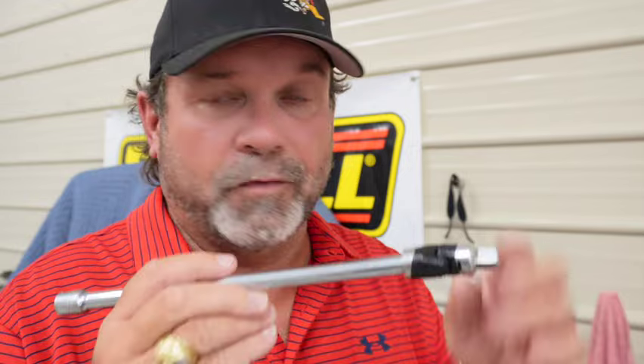If you notice here, there's a universal joint on an 8-inch extension. If you ask yourself why I have electrical tape around this universal joint, go back and look at a previous video on a hack that I did on this — it'll make your life a lot easier when using these. But typically speaking, you take this, put your socket on it, go up in there once you've got your fender well pulled out and your tire off, and you go in there at a little bit of a funky angle and try to work the spark plug out.